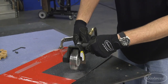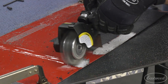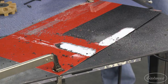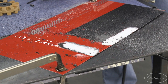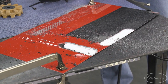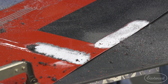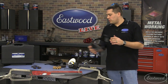Now switching over to the wire brush wheel — watch this tool in its glory. I've managed to make an incredible mess in a very short period of time, but what it shows is: imagine doing a replacement quarter panel where you have seam sealer all around the rear body panel, down in the dog leg area and rocker. You can see how in just seconds it ate this product away — absolutely ridiculous. Instead of sitting there trying to DA sand it, this thing is gone amazingly fast. You'll thank yourself when you're not agonizing over how to get it off.